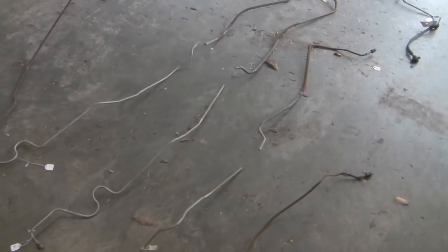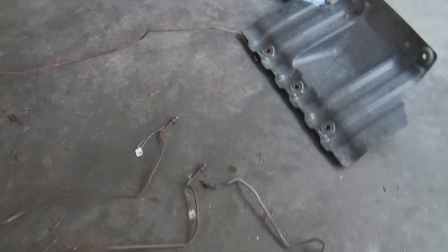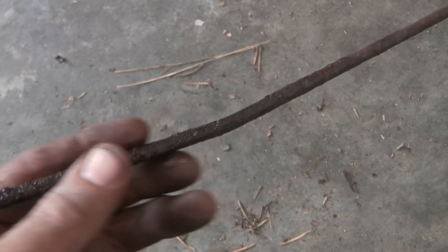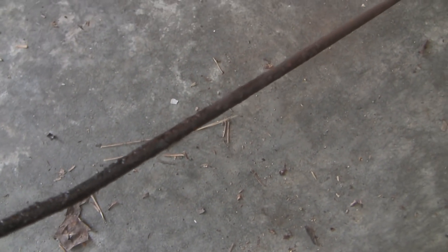You can see I got most of the lines out here. Notice the dramatic difference between the rusted areas and the little of the unrusted areas. I cut most of the lines just to make it easier to get some of them out. I've got the culprit line out as well — the area that was actually leaking is somewhere in this segment here. This is the line that was going to both rear wheels.